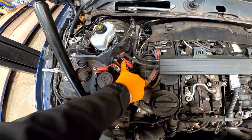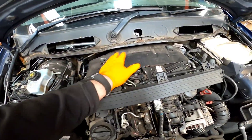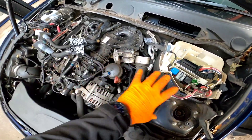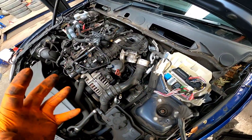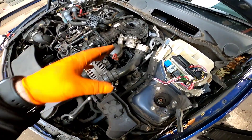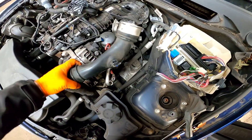Now let's get down to the nitty gritty. We need to remove this live wire strap, disconnect it here from the bulkhead and from the alternator, then we can pull it out of the way and remove this cover. We've got everything out of the way, we've just disconnected the ECU. The wiring loom was pulling over here — on jobs like this it's about making a little bit more room for yourself. It might take a little bit longer but it's going to be easier in the long run. We need to remove this intake pipe from the intercooler and that'll just pull out of the way.